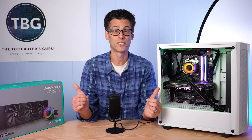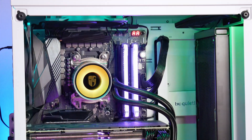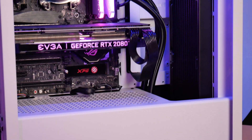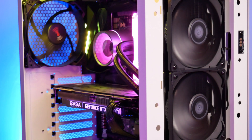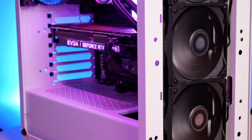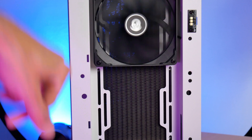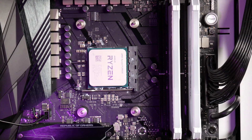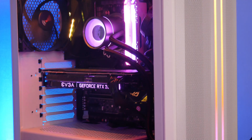Without further ado, let's take a closer look at the two contenders. First up is the Castle 280 EX installed in the front of my Be Quiet Pure Base 500 DX chassis. It has a 280 millimeter radiator with dual 140 millimeter fans that span the full width of the chassis, and that does have a drawback I'll discuss in a moment. Here's the Castle 360 EX, which has a 360 millimeter radiator and three 120 millimeter fans spanning the case from top to bottom. The drawback to mounting a 280 millimeter radiator in this case is that the narrower fan mounts for 120 millimeter fans will actually get in the way of the airflow of a larger 140 millimeter fan, as you can see here. My test bench consisted of a Ryzen 9 3900X 12-core locked at 4.2 GHz running at 1.3 volts under load. All benchmarks were run with the case fans set to the minimum RPM of 350, the fan filter in place, and the front panel attached with a microphone set six inches to the side.